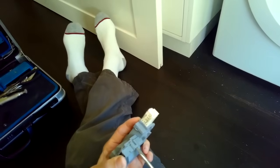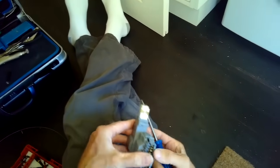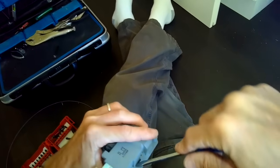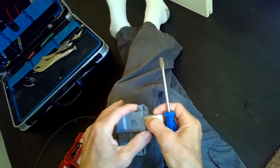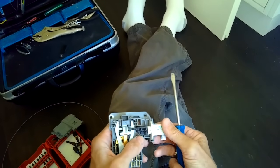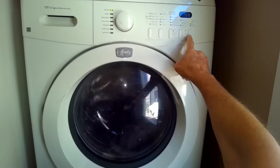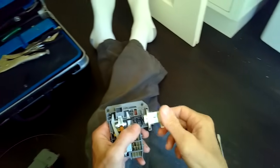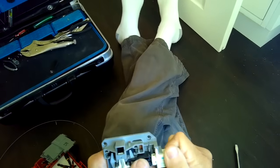Here's the old door lock — I'm going to take it apart and show you how this wax motor works. You can get these wax motors for about $15 on Amazon, and if you buy the whole door lock you're probably looking at $60 to $100. The door lock itself works fine — it's just the little wax motor that's worn out. The wax degrades over time, so you could just replace that piece; wax motors usually last about five years. It looks like the machine is doing agitation and feels really good, so I'm going to stop that, set it for spin, and start it up.